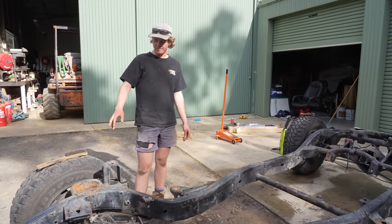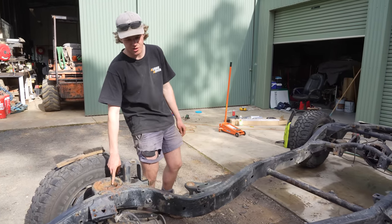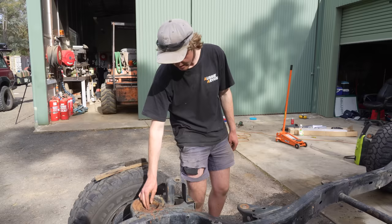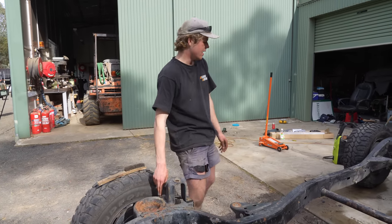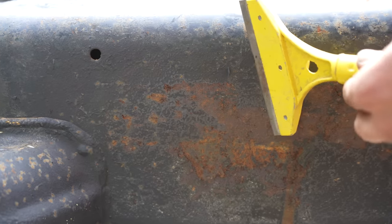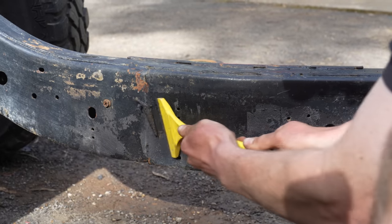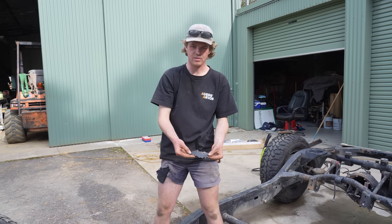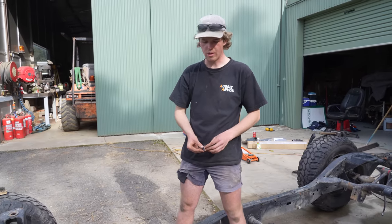We've just finished cleaning up the chassis and uncovered a few things I wasn't expecting. First, there's a fair bit of rust in the coil towers — they had a little plate on them, were filled with dirt and water, and have rusted out pretty badly. It should be salvageable though — no holes other than the existing drain holes — so if I give that a good wire wheel and some rust converter I should be able to eliminate most of it. The other issue is the whole underside and side of the chassis is covered in some sort of extra paint that's flaking off. They've obviously tried to respray it at some point from under the car, so I'm going to have to go over the whole chassis and get rid of all of it before we can spray.